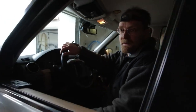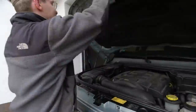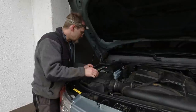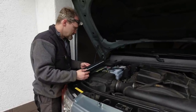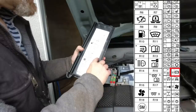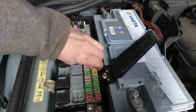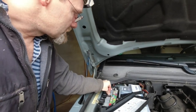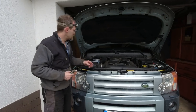Now we've got to take the fuse out. It's on the box — there is also a fuse on the inside in the glove compartment which has a parking brake symbol on it, but you can forget that because it does not completely disable it. You've got to use the fuse here: FL8, 30 amp. I also took the fuse from the suspension out as we always do. Now the parking brake can't actuate anymore. We leave the battery on — we only take it off when we are welding on the car.